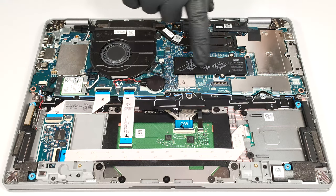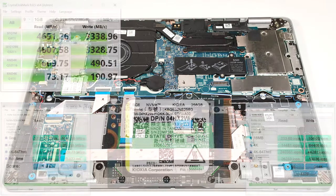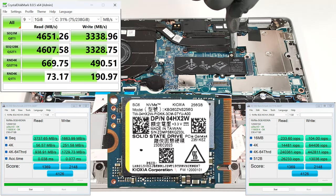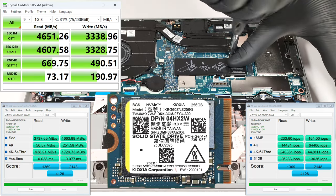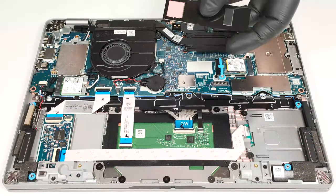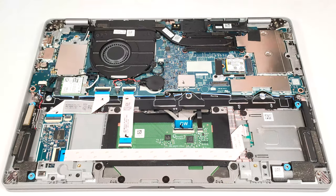In terms of storage, there is just one M.2 slot for the shorter 2230 Gen4 SSDs. The pre-installed NVMe is protected by a shroud that is held in place by two Phillips head screws. The plate has a thermal pad on the end. You have to remove the plastic element in front of the SSD before pulling it out.